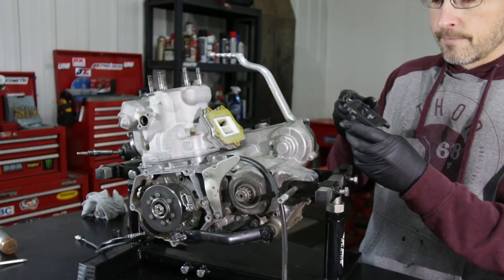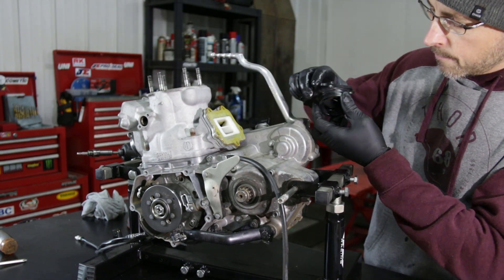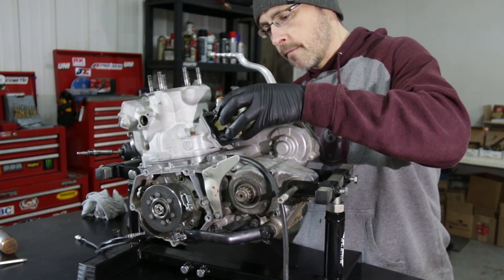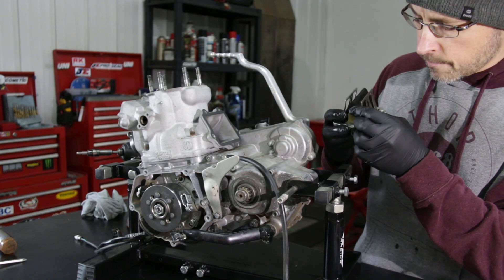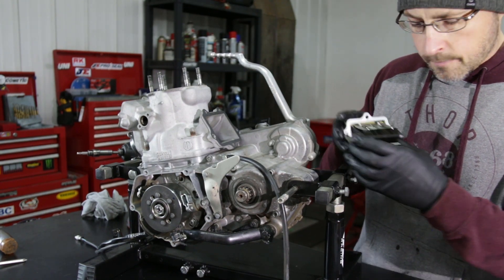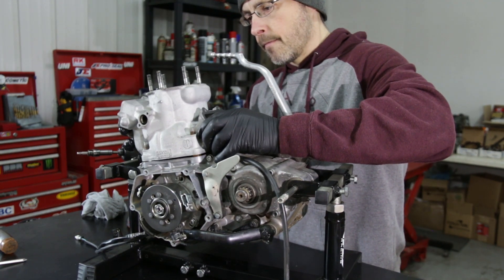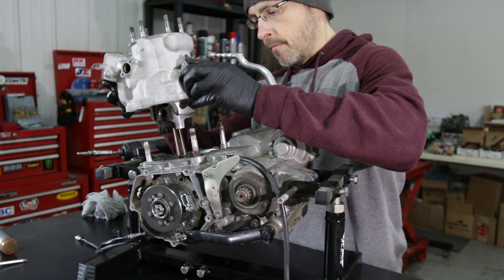With the gas from the carburetor, the boot often dries out, so it's a good time to check for cracks and dryness. For the reed valve, look at the tips to see if nothing's missing or cracked and that they're in good condition. Now he's going to carefully lift the cylinder and expose the piston. Take your time and make sure you didn't forget anything.